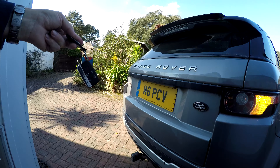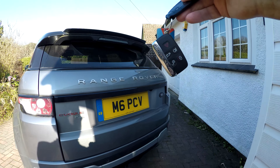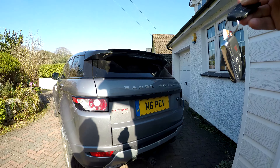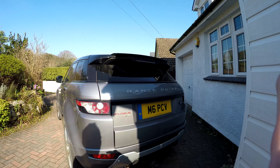Basically it's boiling the battery, so the new batteries I've been putting in don't last at all. It's time for yet another new battery. I think the volts are set wrong, although when I've asked at the service point they say that 15 volts is normal — perfectly alright. I don't think it is, and that's what's causing all the other problems.